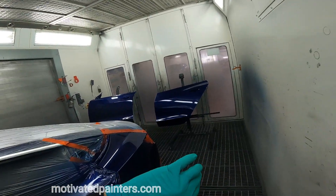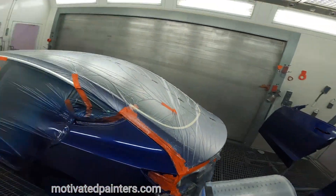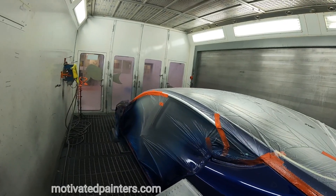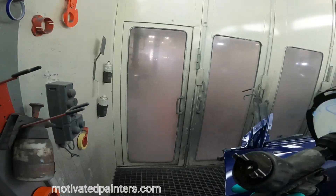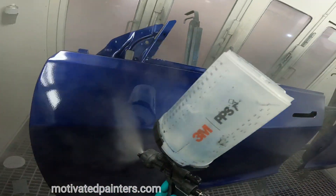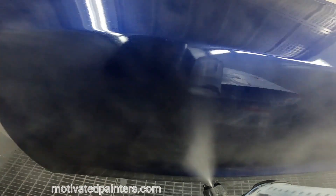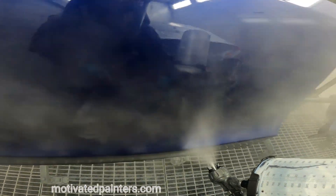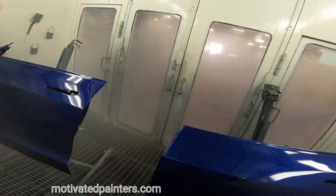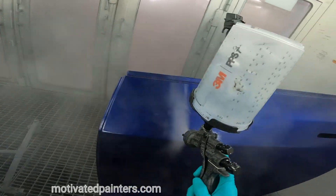Let that flash for 10 minutes — put your watch on it. Also very important: the temperature right now is 75 degrees. Don't do it when it's really hot, but if it is hot, use the slow reducer. I'm using a regular reducer with regular hardener at ECR 85. Still at 30 PSI, and now I'm a little bit farther away and going slow. I've already done the insides so I'm doing the outside.